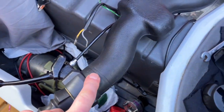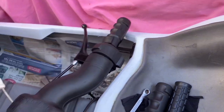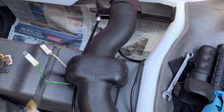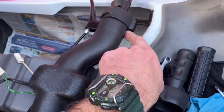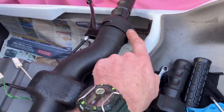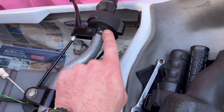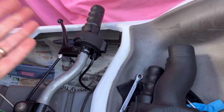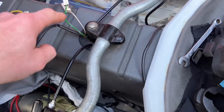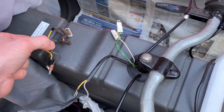What I've done here is put the twist throttle grip on — I like it. The quick summary is that I normally have the throttle button here, and underneath this section would normally be the horn button. What I've done is removed the horn button and put a standard bracket in place so it fits neatly underneath. On this side, I've removed the normal throttle button and put the horn button with the horn-coloured wiring.